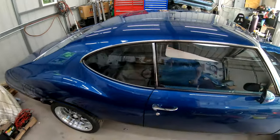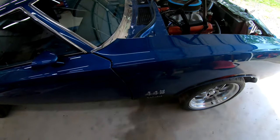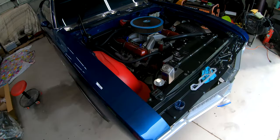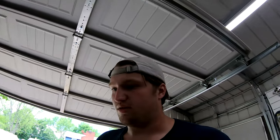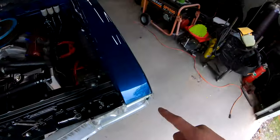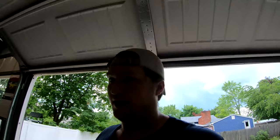The car is probably looking a little different than the last time you saw it. Finally gave it a bath — first time I've washed it in about 8 months. It looks like a whole new car; it's so weird seeing it without a layer of dust. I also started putting the front clip back on, which is a little nerve-wracking to do by myself, but I wanted to keep making progress. I got the passenger-side fender on and the wheel well. We're going to have to reset all the alignments to the body since it changed with the new body bushings. They're just bolted on loosely right now — the gaps are atrocious — but they're up off the floor and on the car. Both fenders are adjusted out of the way so I can open the doors.